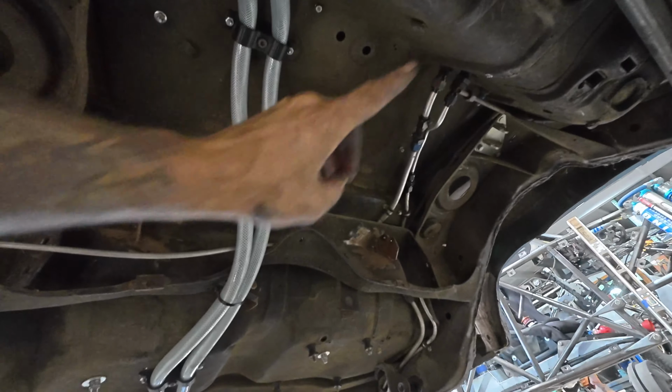The rear end and all the stuff is out. And then we'll leave these in. I think we discussed this because that's welded to the frame, and this is a body mount, so I don't want to get rid of the pockets. We'll leave those there, but maybe trim these up. The other plate goes here, and the tubes will be bent across, and this is where the four-link will sit, and then the other ones go right where these are. But he's messed with all the stuff up front I gave you guys a look at, so we can't move any of this stuff now.